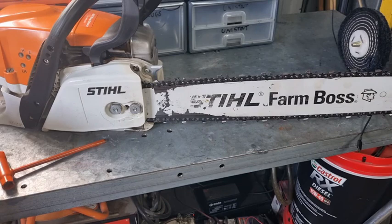That is the correct way and it works well for me. If you've got a brand new chain you'll probably need to do that two or three times in the first couple of minutes. Start the saw, run it for about a minute without cutting wood, give it a bit of a rev — on, off, on — and recheck it. Take it easy, and after about five minutes just stop and recheck the tension again. You'll probably have to adjust it two or three times until it wears in.